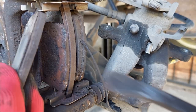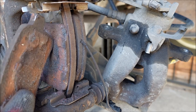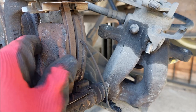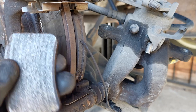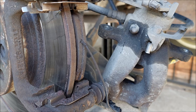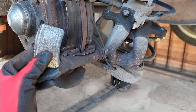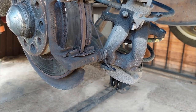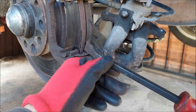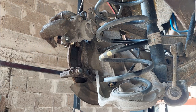I'm going to remove the brake pads. You can see that this one completely separated from the meat, and that resulted in that squeaky sound on this left rear side. You're not going to replace your rear brakes very often, so it's always a good idea to replace brake discs as well to avoid any squealing. If you keep the old brake disc, it already has grooves in it, and that could result in a squeaky sound.